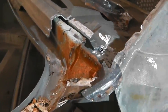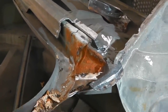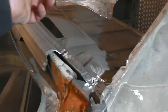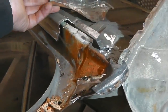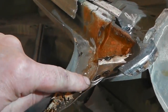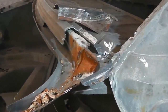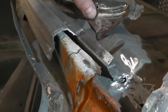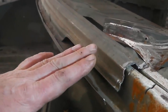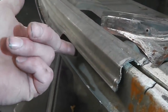Okay, you can see what a difference it makes when you're doing your project to have it well illuminated. So, briefly, that repair piece goes in there on the stagger join, making sure we follow that scribe line that we're about to put in. Okay, let's talk about the airflow then. Look at the back of this area here. This is where our boot lands. This is a rain channel, but it also has air ducts there.